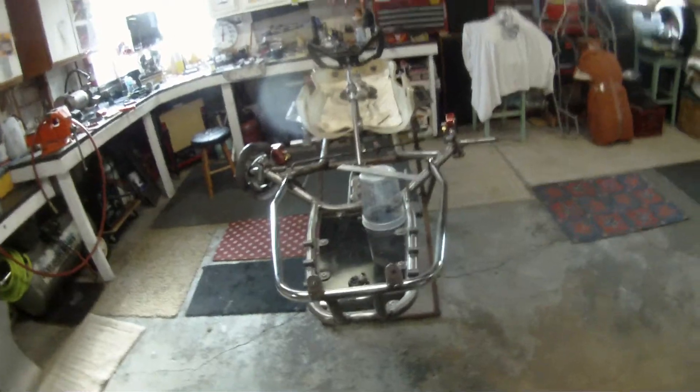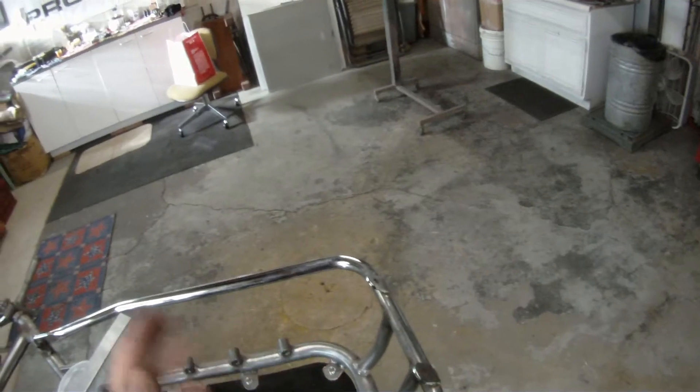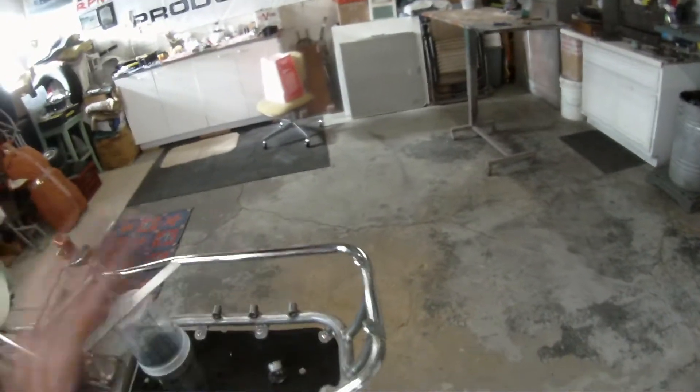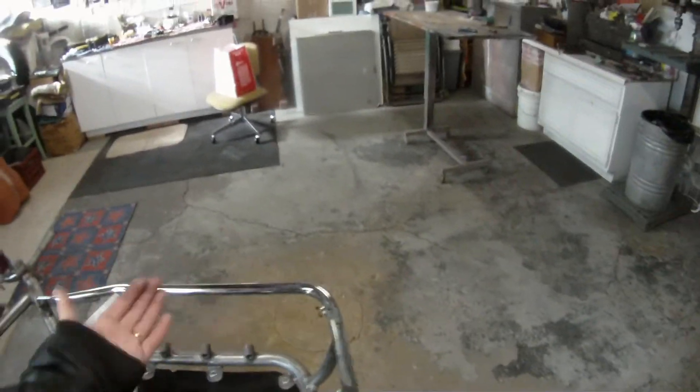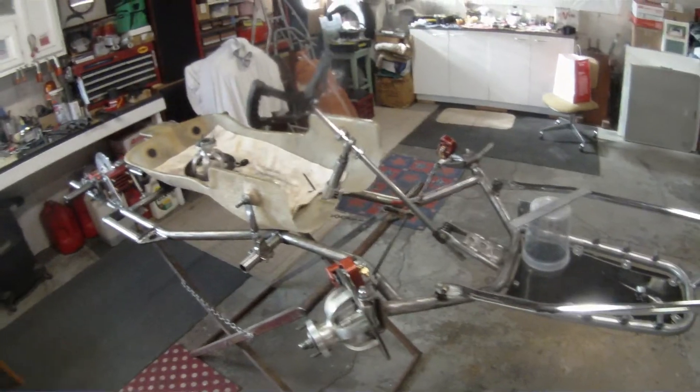Just don't understand it. I am just anal about my brakes — they've got to be spot on. Rather have them overdeveloped, overengineered, as my buddy Bob would say, than not have enough. You can always change the pickup point of the rod at the pedal to give you more travel if you're used to more travel and that little bit is too sensitive for you — you can always adjust the leverage to compensate for the lack of air gap in your pads and how quickly they come on.